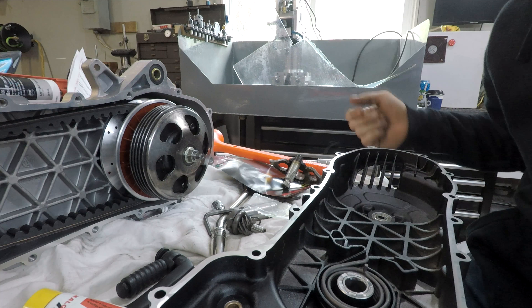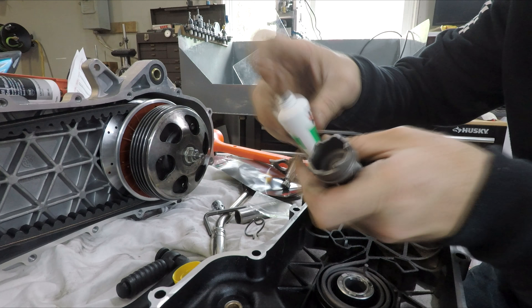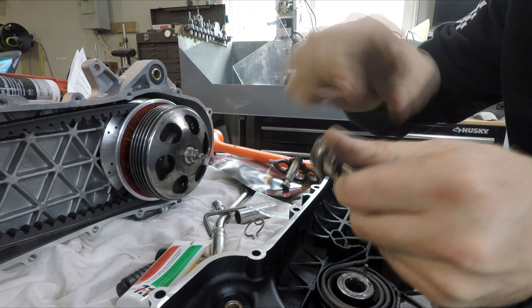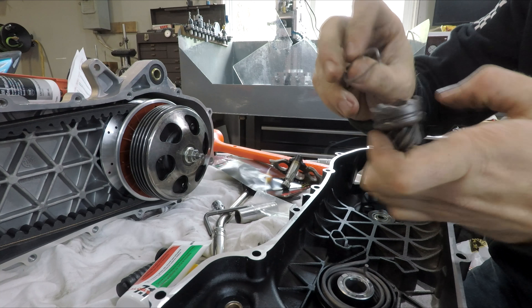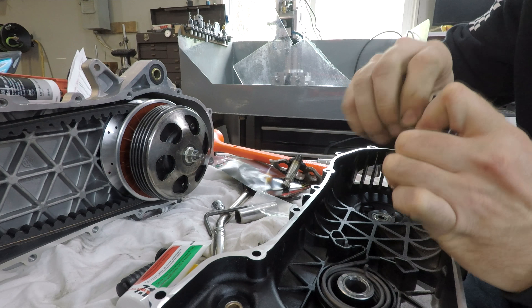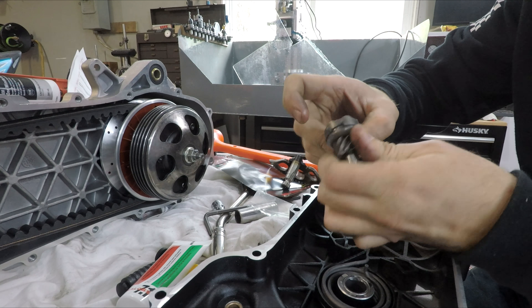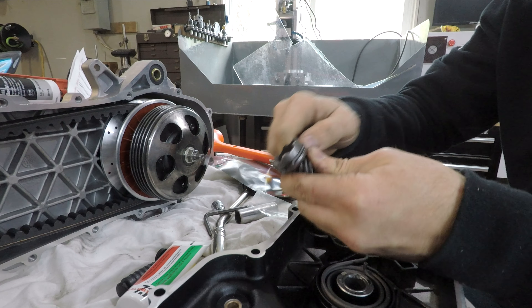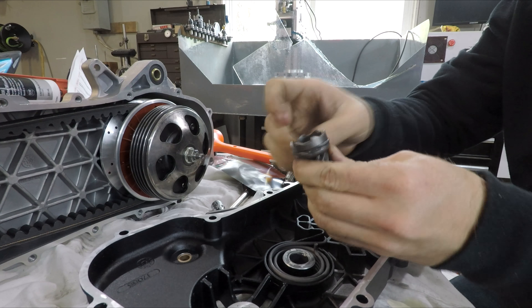The spring goes in like so. Here's a tip they probably don't mention: take a dab of grease and put it in this groove - not a lot, just a small amount - then wipe off any excess when you put the clip back in. This will make the kicker move so much easier and spin a lot freer. A lot of the time when I see a seized kicker it's actually this spring that's seized pretty near solid. Take it apart, clean it up, put a tiny bit of grease on the bearings, and you're good to go again.